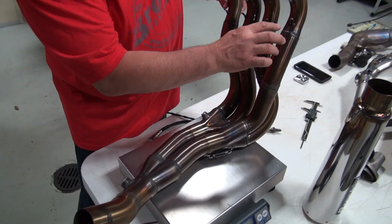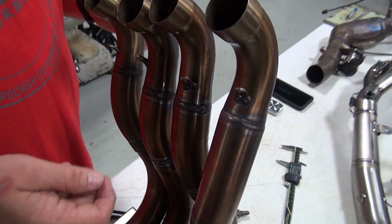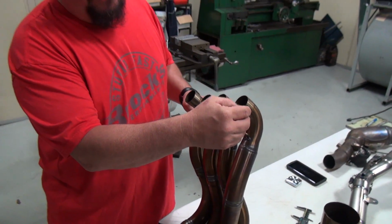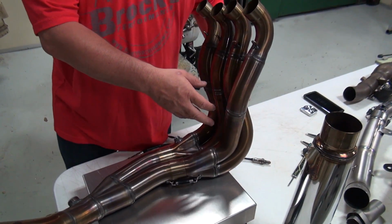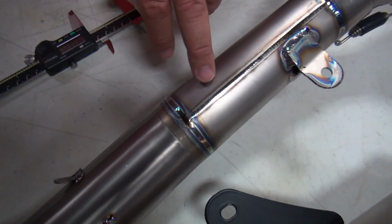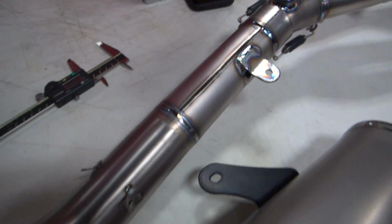When you look at the welds on a system like this, this system has to be MIG welded, which is a wire weld. Otherwise, it just burns through this ultra thin stainless. So every once in a while people say, well, the welds on your Alien Head aren't as pretty as the welds on your Predator, which are gorgeous. This is a TIG weld. And the same thing, the welds on our CT exhausts are just absolutely gorgeous too.